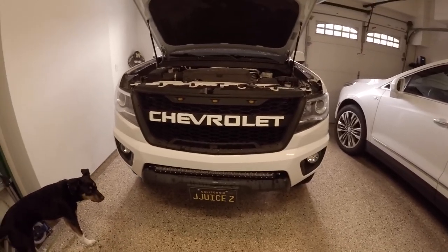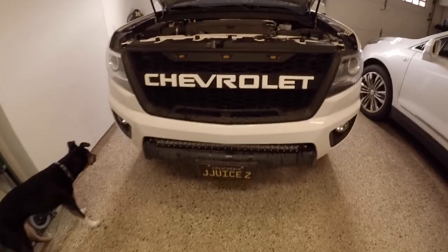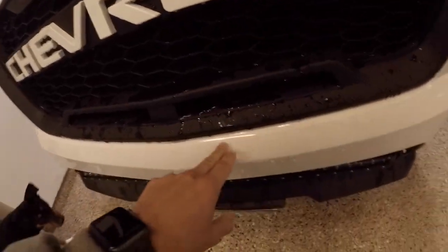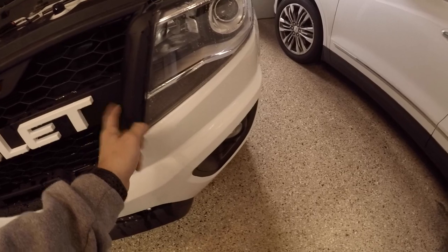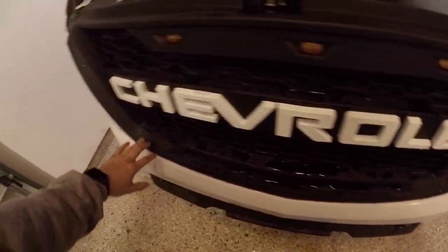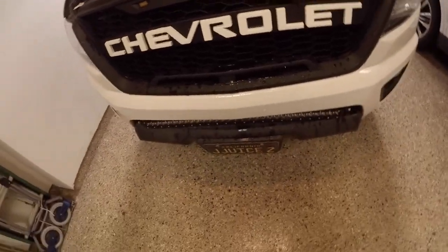From there you're going to lift up on the entire bumper and grille — grabbing from right here usually works — and it might help to have someone else assist. The grille is connected to the bumper with some clips, which you'll see behind the grille. You might want to put down a towel on the ground so the bumper doesn't get scratched up while you disconnect the stock grille.